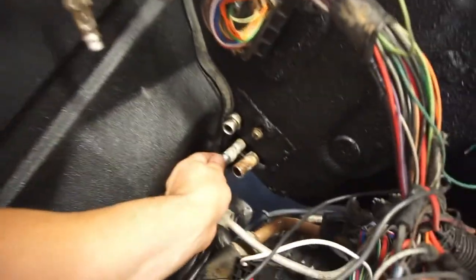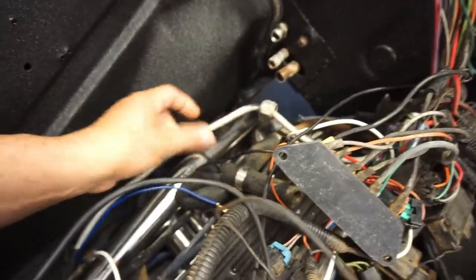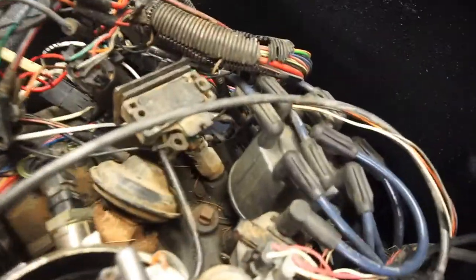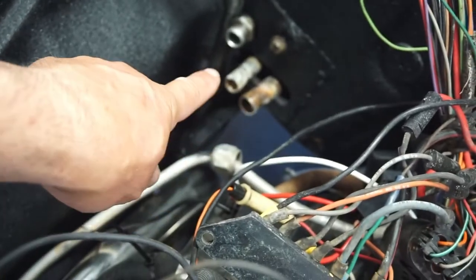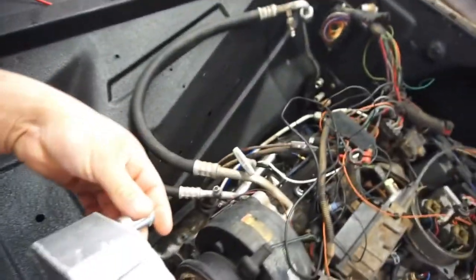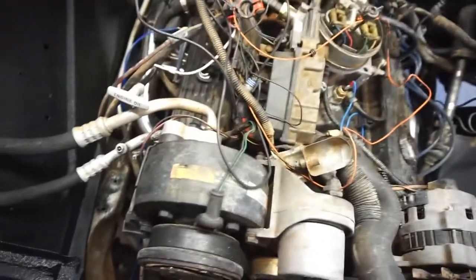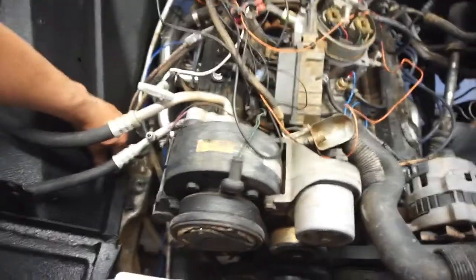That goes to that hose right down in there. Then this hose — I probably already have a little barbed fitting to get rid of that plastic crap. I'll take a barbed fitting and some hose, and I think that's 3/4 inch. I'll run 3/4 inch hose into that side, then run the 5/8 inch out of there, up and along, wherever. I'll probably have to run it on the firewall here and then run it up, because I don't want it too close to the header. Got those in the mail.